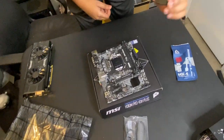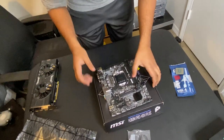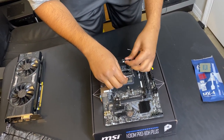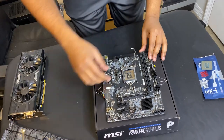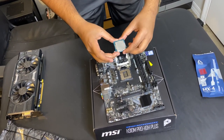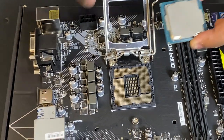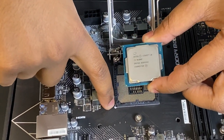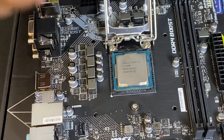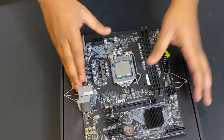First thing you do when installing a CPU — you probably shouldn't be putting it down like this, but this is an old model so we don't really mind. Let's go ahead and install it. Pull this arm back and you can pull this up, then remove this piece right here. We're going to open up the retention arm and drop the CPU in. What you're looking for is this triangle right here on the CPU — we're going to align it with this dot right here on the motherboard. Just go ahead and drop it in, make sure it's in, drop this down, and put the retention arm back on. And your CPU is installed.